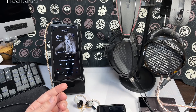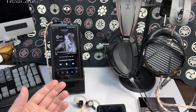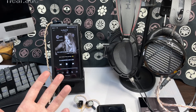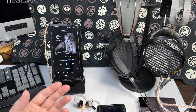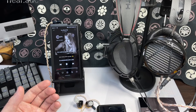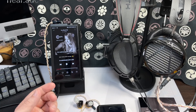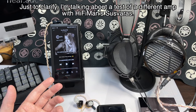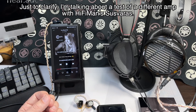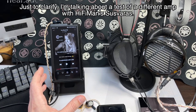It's very easy to get much higher SPL with very low bass content. For example, with a track like 'Cradle to the Grave' from a movie soundtrack — designed for cinema with very low bass rumble — I found I might be listening at 70-80 dB with a vocal track, but with that bass-heavy track I was actually at 90-100 dB without it sounding particularly loud. The bass was putting heavy demand on the amplification and I actually got an amp to clip that way, confirmed with the manufacturer.